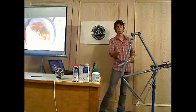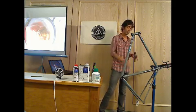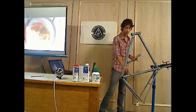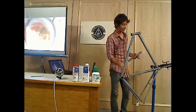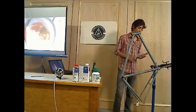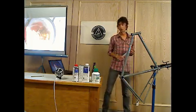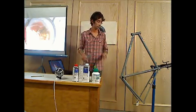after a pass, one coat, and you just want to get it as dry as possible before putting the next one on, especially with intricate masking, because if you're putting wet on top of something that's still wet, then you're going to get kind of a messy line, which is so important for stuff like this, for little letters and all these intricate things. You really have to get it perfect. So yeah, a few coats of that, and then we'll move on to clear in a bit, because that's the craziest thing.